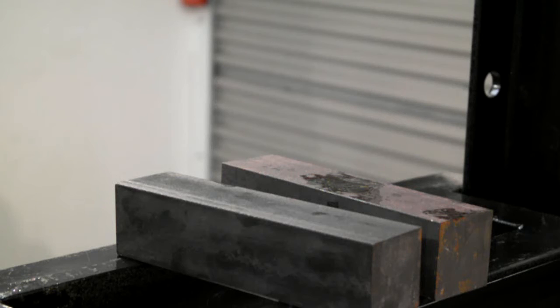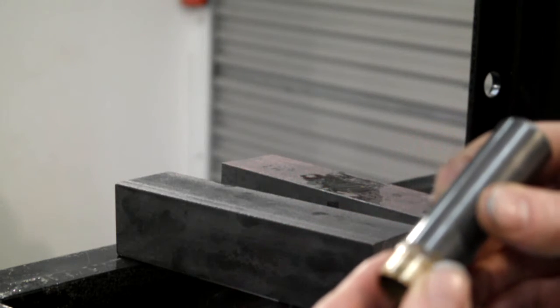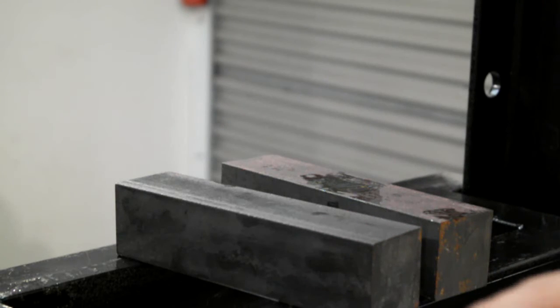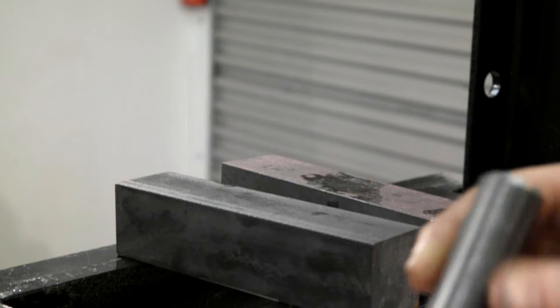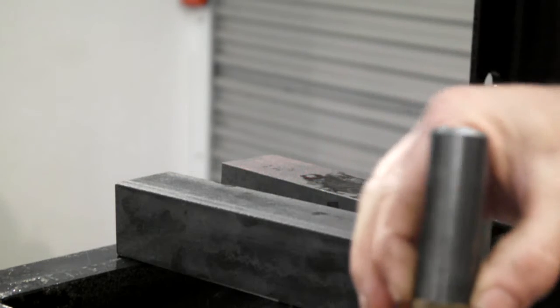So that's that out. As I say, I'll get a proper bit of kit. What I'm wanting is the same size as that, but turned so that it sits inside the new bush, as the actual new bush is smaller internally than this. I'll get it to sit inside, and then it holds it straight and pushes it in straight.